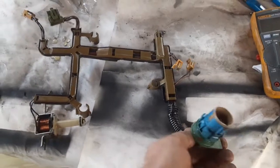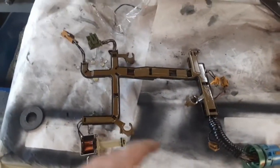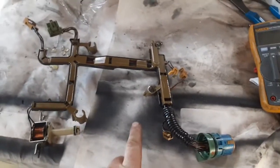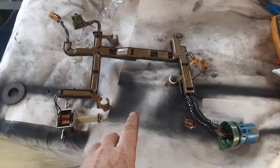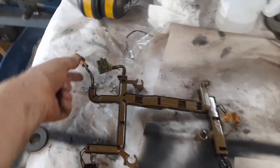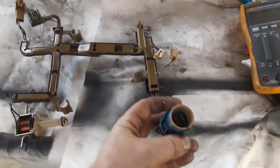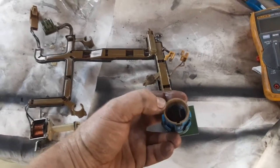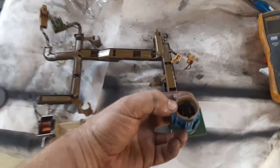Here's the internal harness to the original 2012 4L60E. You can tell the 1999 to 2006 style, and then it changed in 2007 to 2013 when they added this internal speed sensor. You can tell that externally by looking at the plug which is normally at the top of the transmission on the outside — if it's green it does not have the speed sensor; brown has the speed sensor.